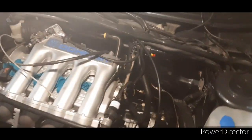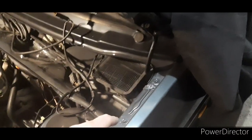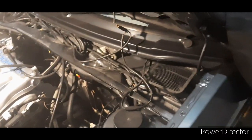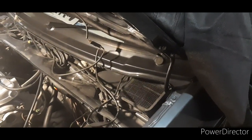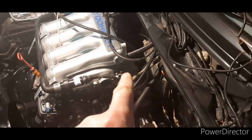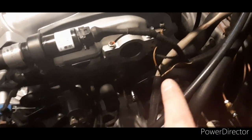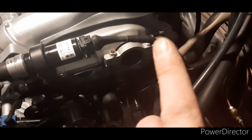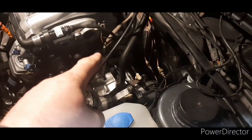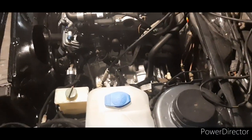Then it's on to fitting an earth strap. I've got to put an earth strap from that stud on to one of the hinge bolts, but obviously those hinge bolts I need to paint Atlas Grey, so I'll get a touch-up pen for those. Once I'm happy with where they are and they're tight, then I can just paint them over. I've got another earth strap that needs to go from one of those bolts in the coil to that point there. I still need to do an earth point on there. That's waiting for the hoses, and then I need to dig out the other hose which should go up to the head tank - I think I've got that somewhere, so I'll reuse it if it's any good.